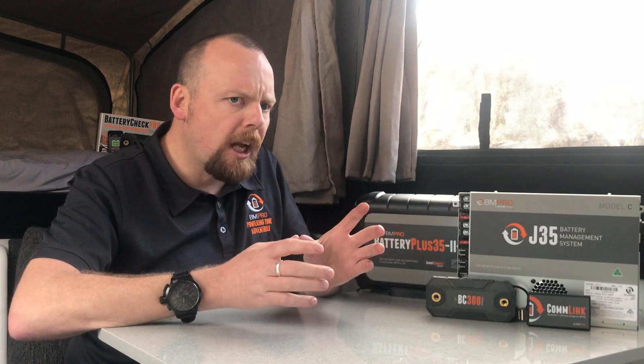There are various different brands on the market, so definitely do your homework when looking to add a panel to a system. Everyone's application is going to be different. On this particular camper van, we've got one 160 watt panel on the roof and that's more than ample. We have a total of four lights in the main living area and a couple of outside lights. We won't get the full 160 watts from the panel because it's flat-mounted onto the roof — straight away there's a performance drop-off of about 30 percent, so where we might have expected 12 to 13 amps, we're really only putting in about 8 amps.